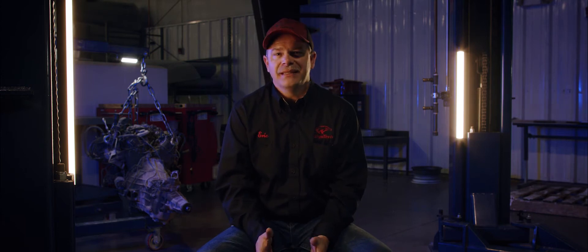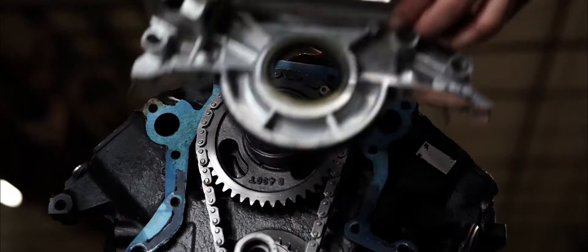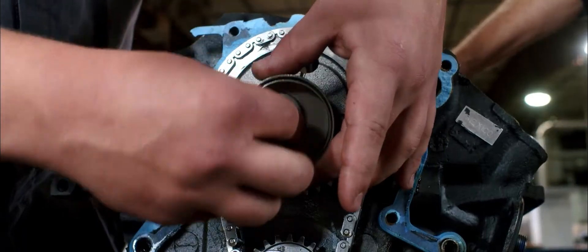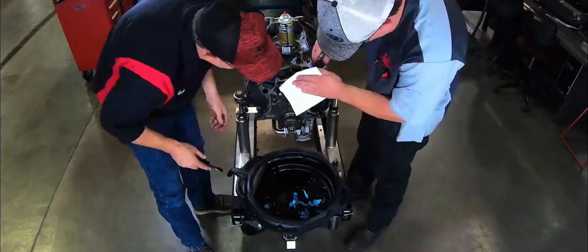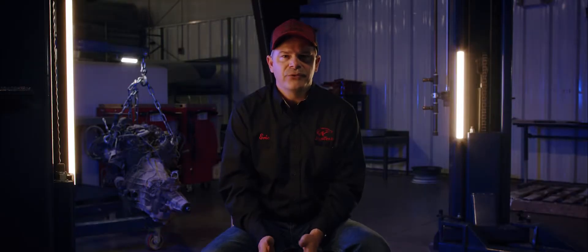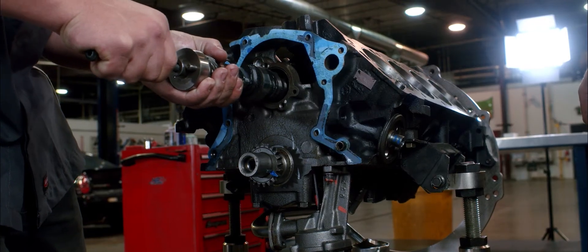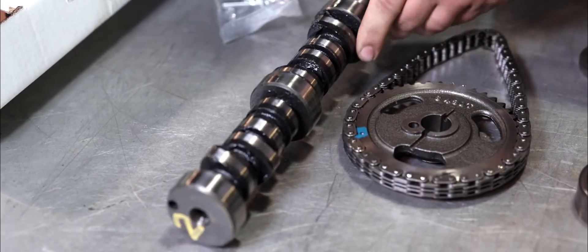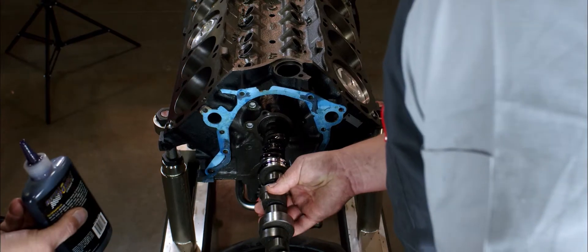One of the key things that you've got to do is pull the engine apart. Unfortunately, this is a brand new engine that's already been resealed, but now we've got to pull it all down — pull the oil pan, pull the timing cover, pull the timing chain. We've got to clean and scrape gaskets off, being very careful on aluminum parts not to gouge or trench in with any kind of scraping tools. Then we're going to pull the camshaft out and put a whole new camshaft in with a little longer duration, a little bit more lift — something that's going to make this engine sound nice and healthy.